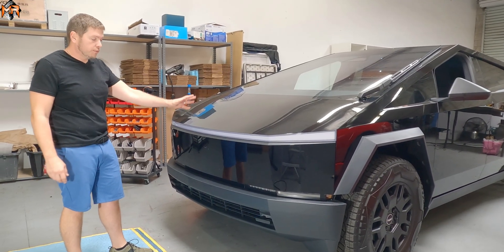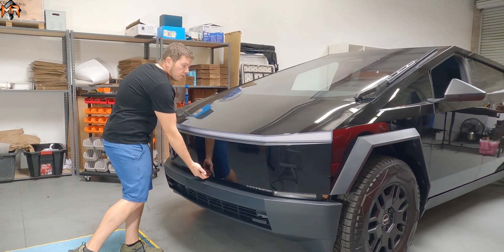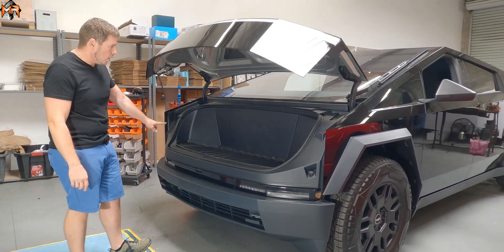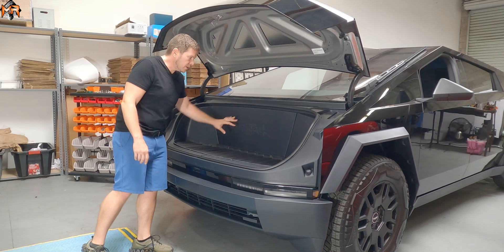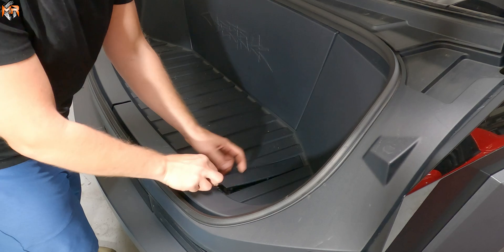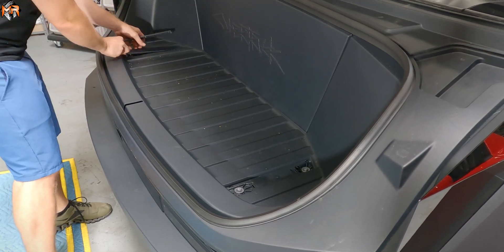The first thing I'd like to do is take out the front liner. The reason we're doing that is when we're routing the wire, we're going to be connecting it underneath this liner panel. So let's go ahead and remove everything from here — take off these two covers, there's one on each side.